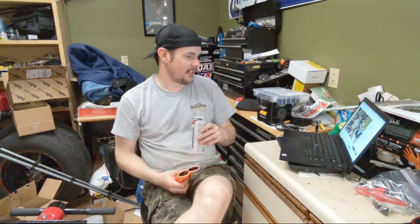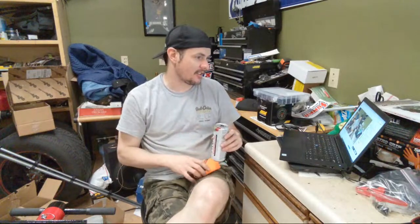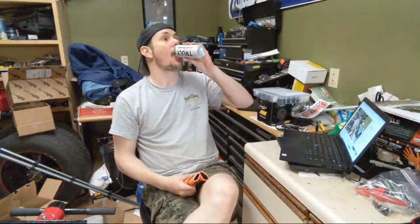5.3 Gen 4 internals with an 88 millimeter. Nothing wrong with them. Just big ass injectors with a big ass fuel pump. Ooh. I have not had that problem, Shino, but I would be very spooked if I watched the fuel pressure drop down to 20. What mods are on that? Are you just running out of fuel pump? Because that's what it looks like.